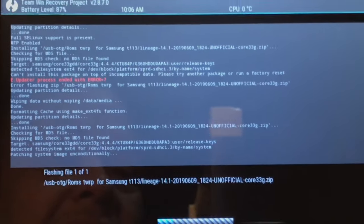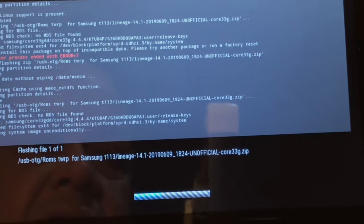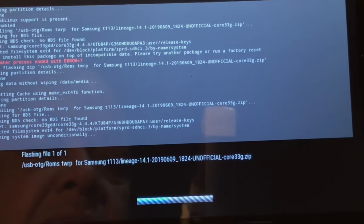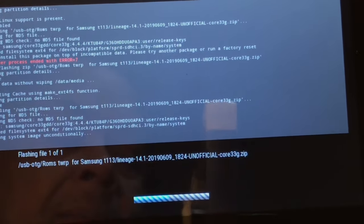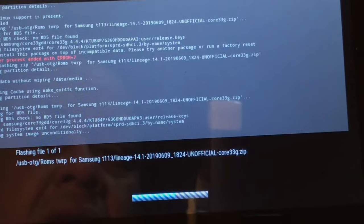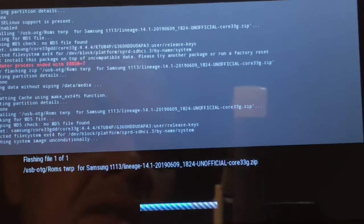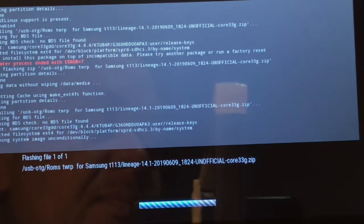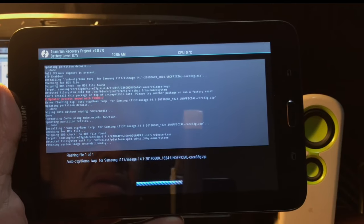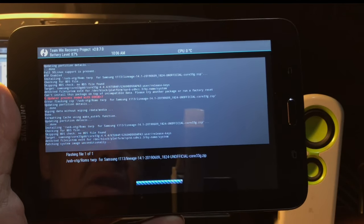Eh? So, because in fact, the operating system was already resetted, I could do a clean, fully clean install, but sometimes it's better to do a dirty install just in case, boot ROMs and modems are not, you know, compatible with the original one, so you won't end up with a device that has no Wi-Fi or so. So there's one little problem about this ROM. The cam is not working. Okay, so maybe we'll find a fix for that. But for now, the cam is not working.